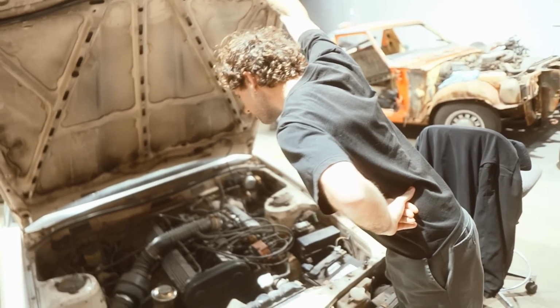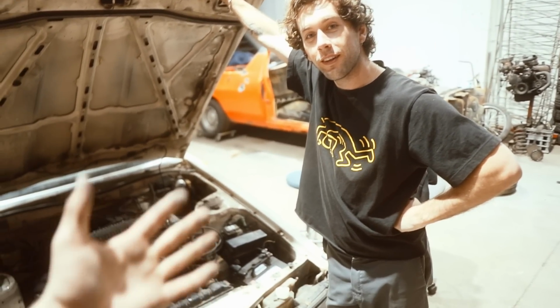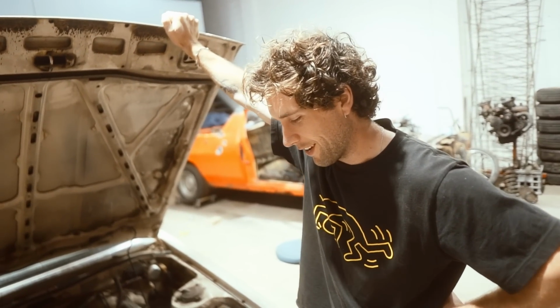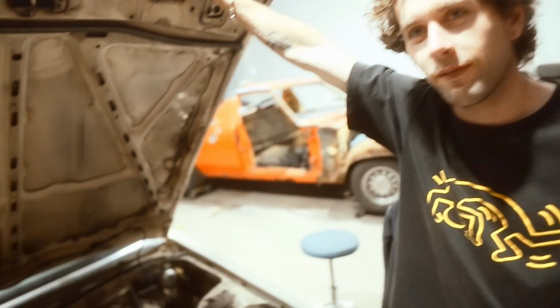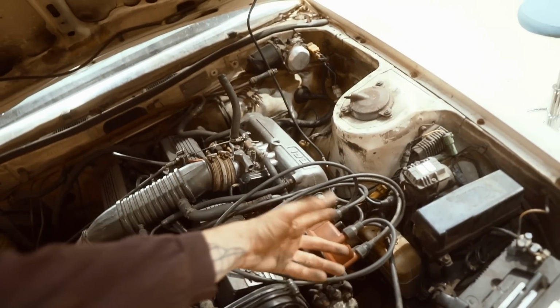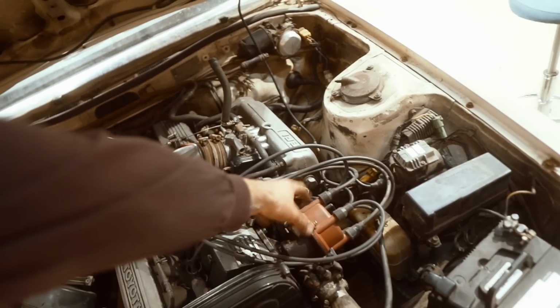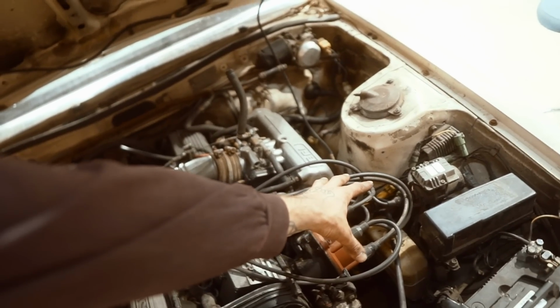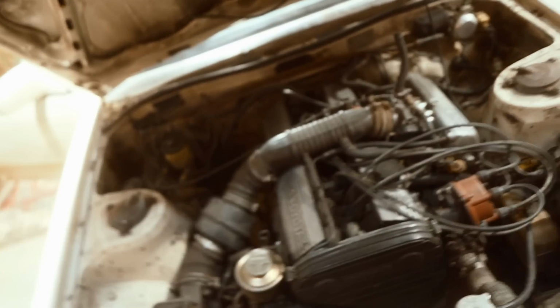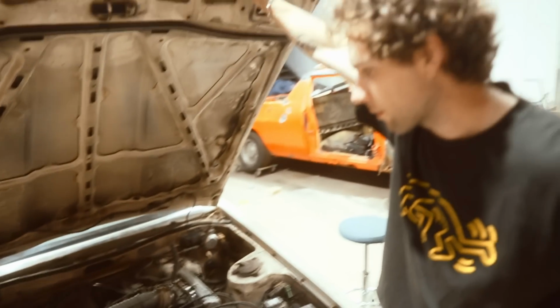Some sort of other radiator. One thing goes in front of the radiator. And I've also been thinking about how to make this face forward. If I went to a Link ECU, I could run this as a CAS and then have a forward facing plenum and then go around like that.